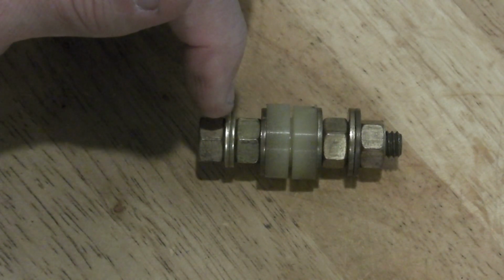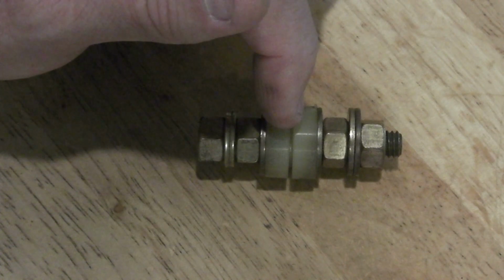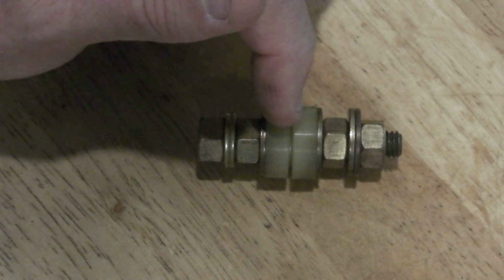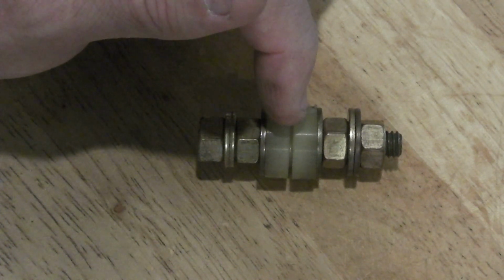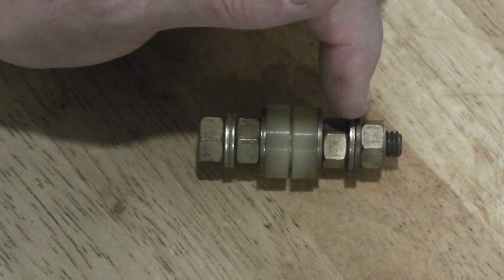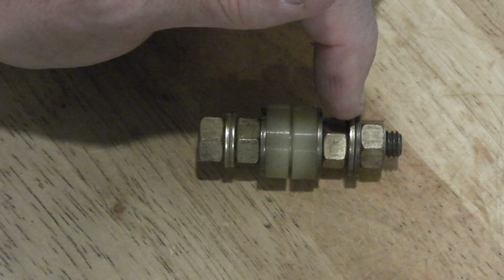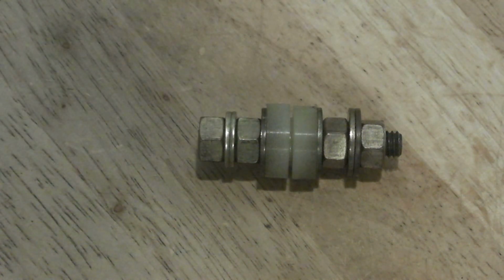Those are the power leads in the engine compartment coming over from the alternator. The bulkhead connector plate is sandwiched between these two insulators. And then these are the brown power leads on the interior of the vehicle, going to all the different places that those power leads go. And that's how the stud works.